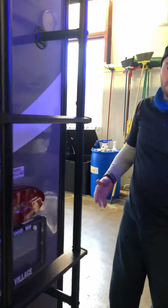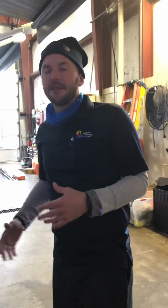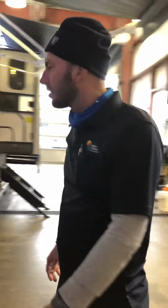You have a ladder on the back, which is nice. I recommend to get up on the roof at least twice a year to inspect the roof and the roof material and all the sealant up there. I always recommend like at the beginning and the end of every camping season. We got up there and inspected it this time, so you should be good. But come springtime, I recommend to get up there, wash it, inspect it to make sure all the ice, snow, and water sitting over it through the wintertime didn't cause any damage.